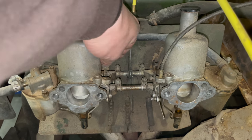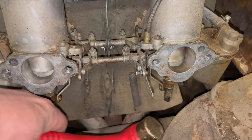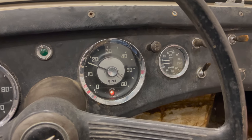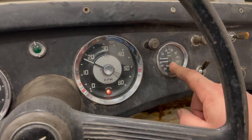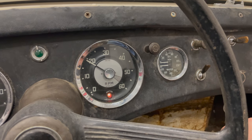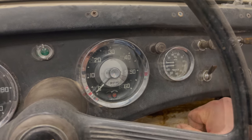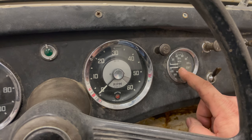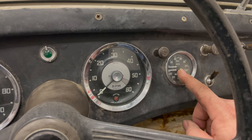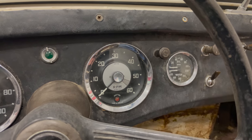The throttle looks okay, the throttle was not stuck. Let's see if we can tap the jet back up. Okay, second try. See if our oil pressure builds up. Well, the car runs pretty good now. I did not see the oil pressure go up on the gauge. Sometimes the oil pump just needs to be primed. There could be a problem with the oil gauge altogether, or there could be a massive leak and it's just not getting to the gauge. So I need to go take a look and see what's going on there.